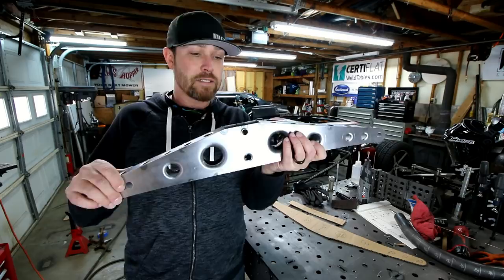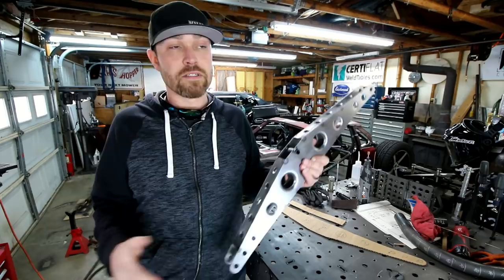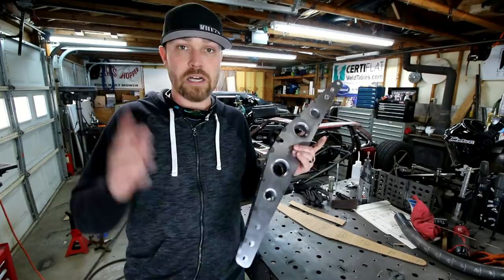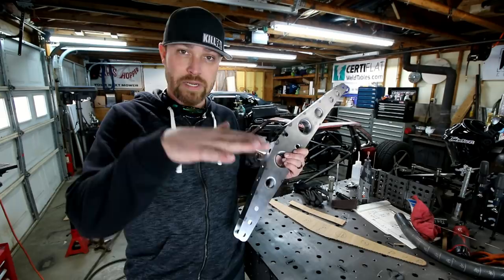The hydraulic cylinder will be at full extension at ride height, so I won't have to worry about any issues with fluid moving around from cylinder to cylinder, or pressure issues. Basically, I just fill that thing to where all the cylinders are locked out. That's ride height. I rock and roll. When I get where I'm going, I just dump all the hydraulic fluid, and then it'll sit down on the ground. Probably put some slowdowns in it, so it'll have a nice gentle downstroke.